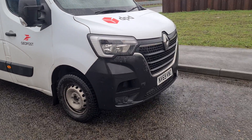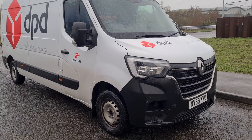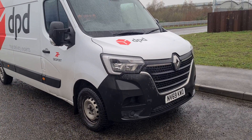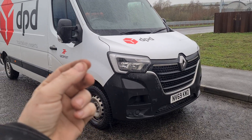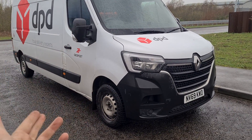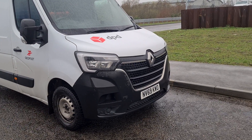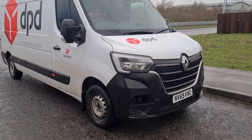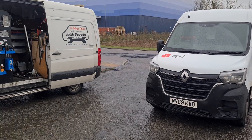Just be aware that when you're buying aftermarket mirrors, not just these Renaults, but most new Euro 6 vehicles — what they do is they use that sensor to run a lot of other systems. In particular, your AdBlue tank has got a heater inside, and when it gets cold, that will activate the tank and the heater. It also uses the temperature for many other things, like how much fuel it wants to put in, air and fuel mixture, all of that sort of stuff. So yeah, just be aware of that when you're doing it. I'll see you in the next video.